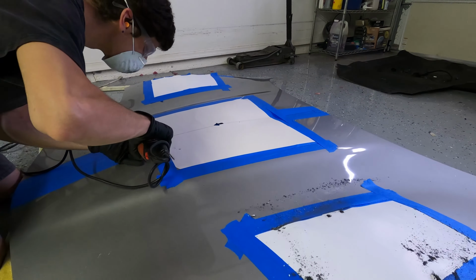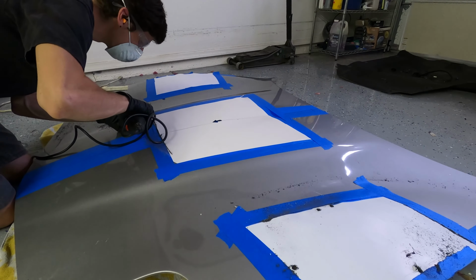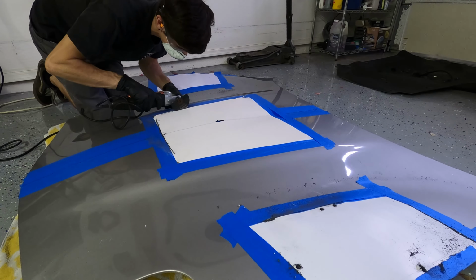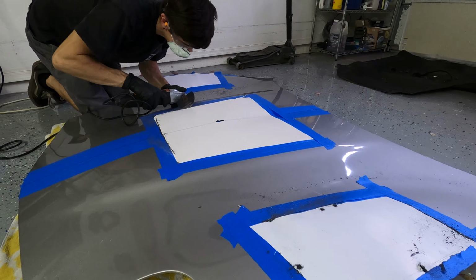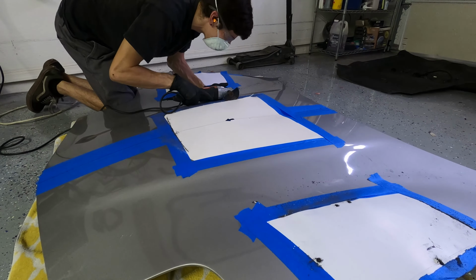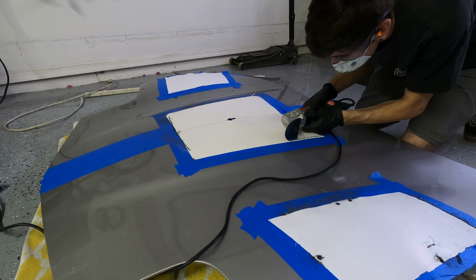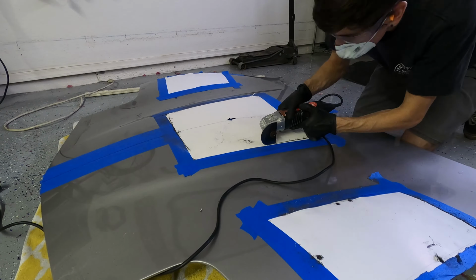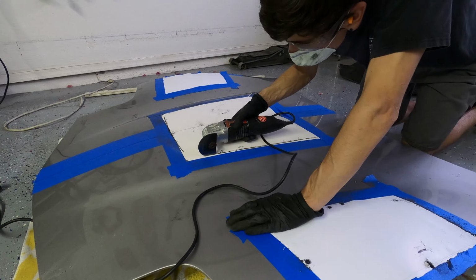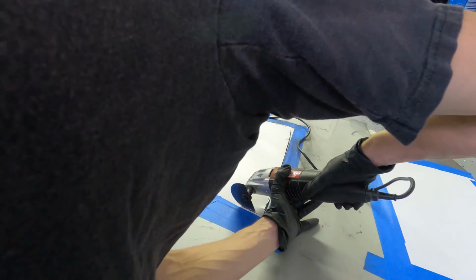So overall, I think this multi-tool worked out pretty well for cutting fiberglass. I did start off with using a drywall slash wood blade. It did chew up that blade very, very quickly. I was thinking that fiberglass being somewhat a soft material, it would work well for that. So what I ended up doing was switching to a bimetal blade for cutting screws out of wood or nails out of wood, and I think cutting metal itself. So it made quicker work of that.